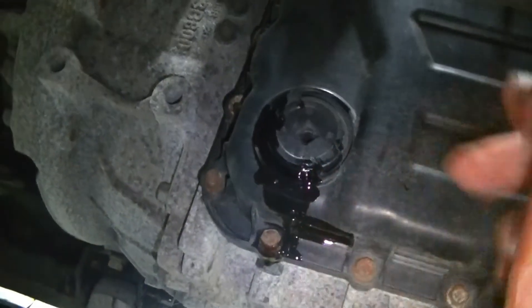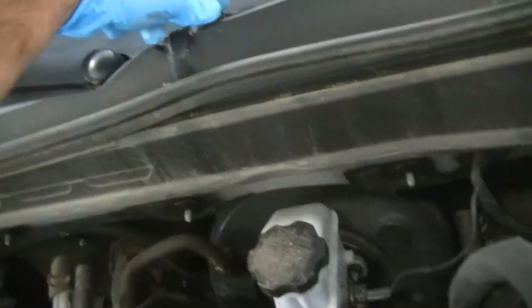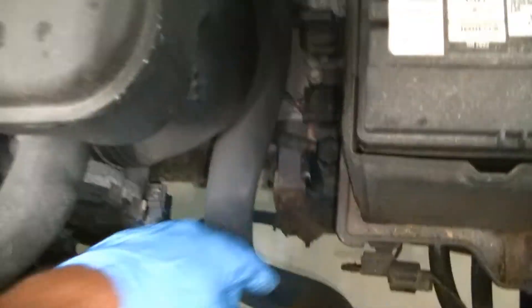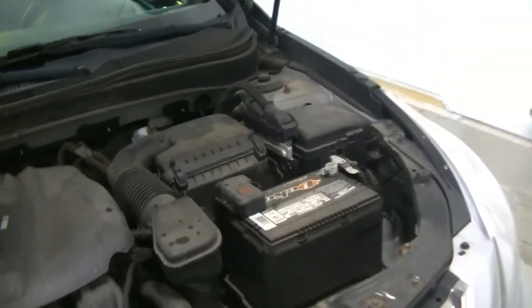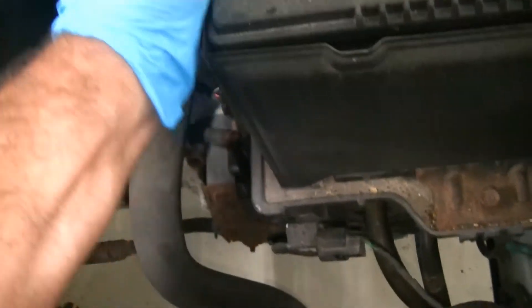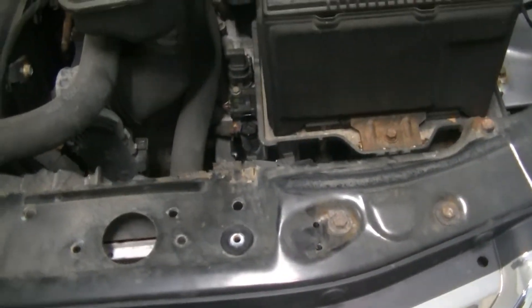We're going to go ahead — you should almost be able to put this back in by hand — tighten that up, clean this off, and put our underbelly shield back on. Your transmission fluid service is now complete. And if you're lucky, we can go ahead and return that sixth quart of fluid we didn't use. Like you saw, we reconnected the trans cooler line. All we're going to do here is put our plastic fill plug back in and snug it up. Then all we have to do is put our air snorkel back on with the two 10-millimeter bolts.